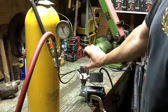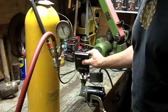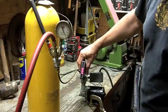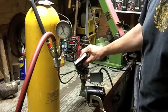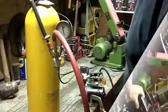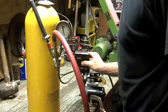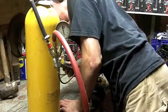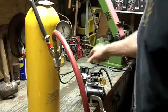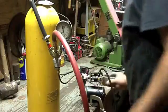This should be at its hottest possible time now because it's really squeezing air. Reading 90 degrees, then 88 degrees lower down, and cooling fins are 84. At about 14 minutes it's still running — cylinder head sitting at 94 degrees. The cooling fan works great; the cooling fins and fan are most excellent.